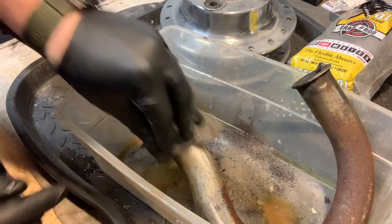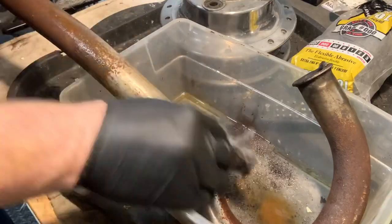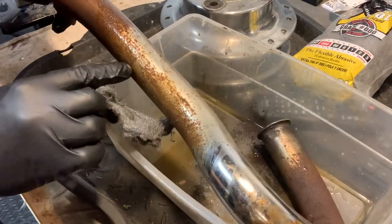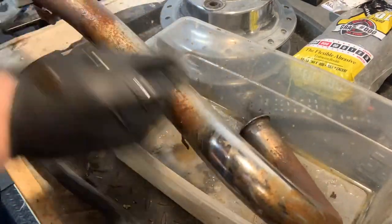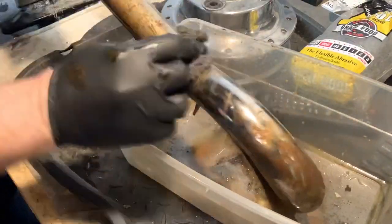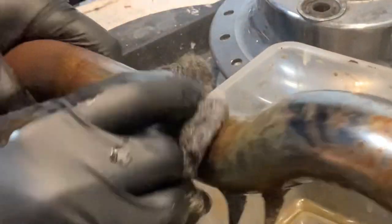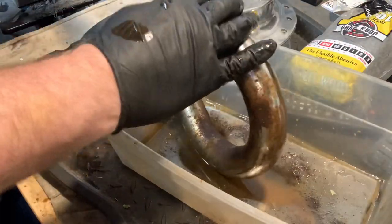I hope you guys can see the progress I've made just in the last 30 seconds or so on this pipe. It's going to look respectable. Let's go over to this rusty spot so you can see a before and after of this section I'm working. Drop my steel wool in here and let's just give it a wipey wipe and see if we can knock this stuff out. I can try some bronze for those of you who are against using steel wool on chrome, which I totally understand. Although I do think a 4-O steel wool is light enough for anything you might be doing with a chrome piece.